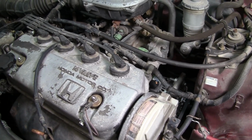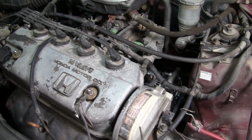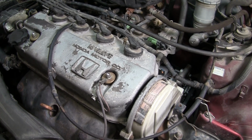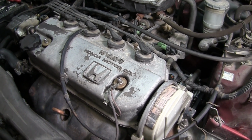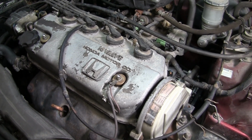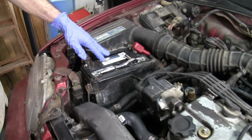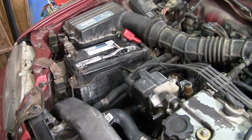It was at 12.19 on the volts. Should be at, what is it, 13.5? It should go up to 13.25 to 14, and it didn't. As you're driving, it's recharging the battery, and the battery should be at about 12.6. So when it was at 12.18 or 19, it's lower than what the battery charge is, so it's not charging up the battery as you're driving. So I was going to end up having the same problem.